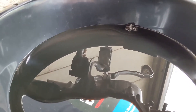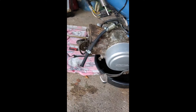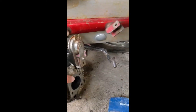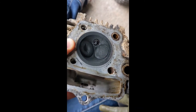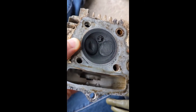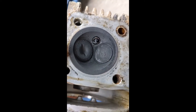I've got this far — I've got this section off. You can see it's kind of black inside; it shouldn't be black like that. There are the valves. So there's definitely oil been getting in — that shouldn't be like that at all, so that needs cleaning up. You can see the spark plug where I've just left it in there; that's all blackened as well. I'm going to get that sorted out.